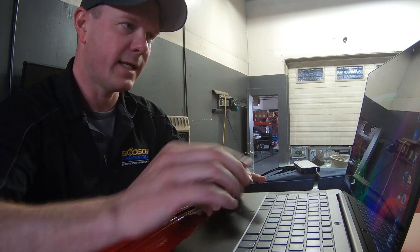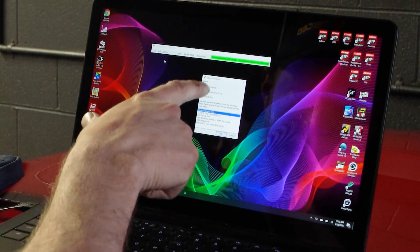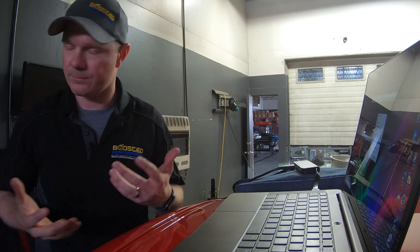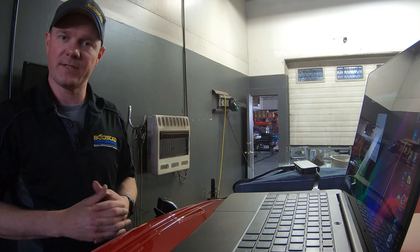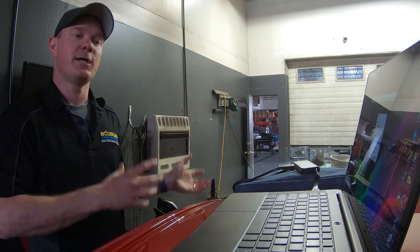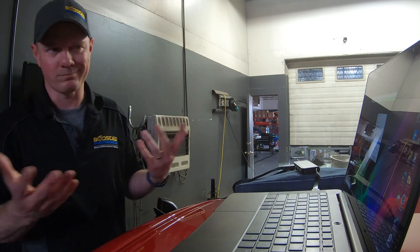Now you're ready to go here and click on Tools, then Detect Vehicle. You'll see it runs through a little process and it identifies that we've got a BMW B58 vehicle. One of the first things you're going to do if you've never tuned the vehicle is you're going to attempt to unlock it. On most vehicles, you're going to be able to do that just fine. It is possible to have a special newer ROM file on these cars that cannot be unlocked at this time using the Ecutech tool. If we run into that, it does involve taking out the ECU and shipping it to somebody to be unlocked on a bench. That's starting to be pretty common with newer vehicles — some of the Porsches work that way.